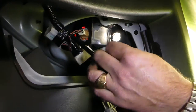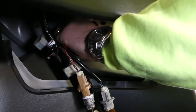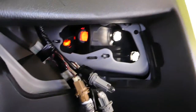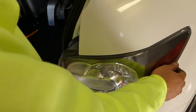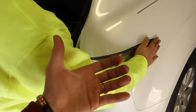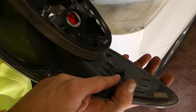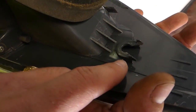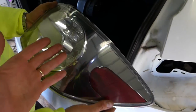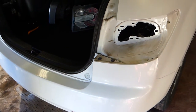One bump out, second, third, and we have one little parking light. Grab on this side a little bit first, then grab it really tight and pull. If it's never been removed it will take a while — possibly two people — because there's a clip right there that holds it and it tends to be really tight if the tail light has never been removed. The driver side will be identical, and now we can proceed with the bumper.